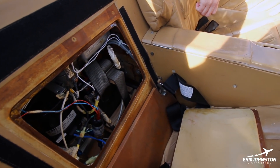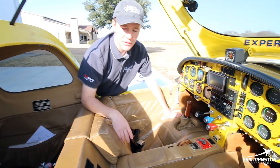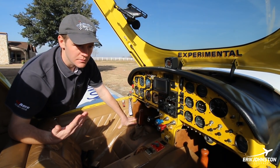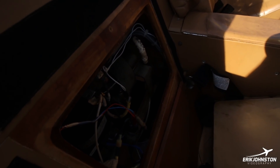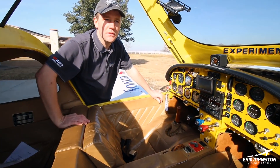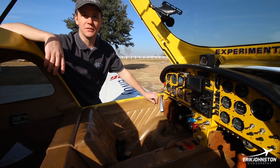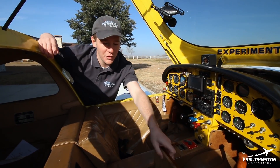When I first bought this, I was flying it back from Virginia. I landed for gas — everything had been going great over the previous two or three days. I went to start it, it powered up fine, but as soon as I hit the starter it just stopped. I had a volt-amp meter but hadn't noticed anything weird in flight. Turns out the Concorde battery had been in there almost five years and went bad. Luckily I'd landed about 30 minutes from a Jabiru aircraft dealer, who had an Odyssey battery they use in their Jabirus. I drove up, bought it, installed it, and made it home. I always seem to break down on Easter.